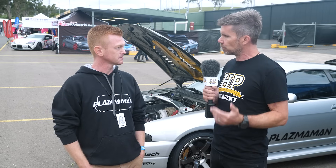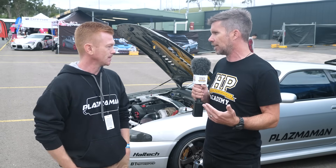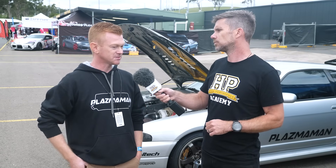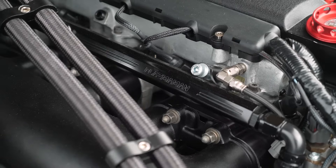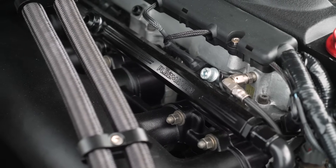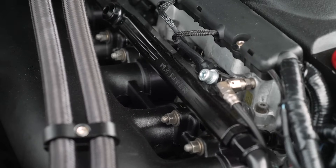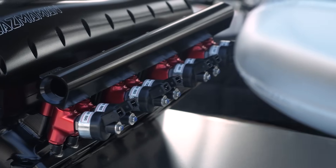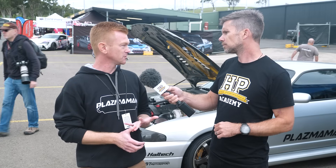The other element you talked about was fuel system restrictions — can you elaborate on how you can address that with your plenum chambers? Sometimes it's very hard to get a large enough injector in a single position at that power level, and your cold start, cruise, and general drivability will be affected. By going to two injectors, you can run one small injector and one large injector — the small one for cold start and cruise, and the large one for wide open throttle.